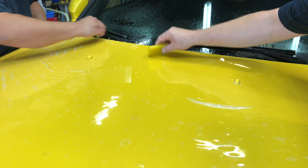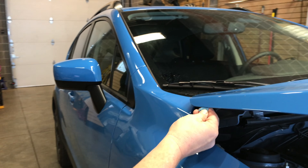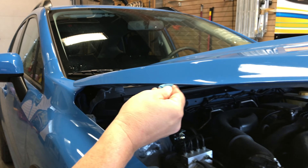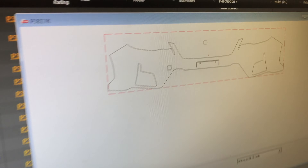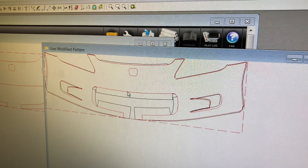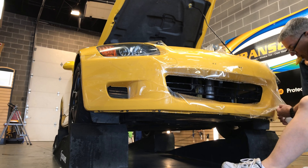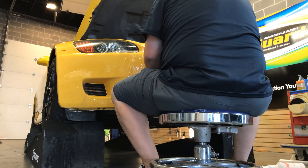You can lock the film in place by squeegeeing down a single spot, then continue to squeegee and stretch the film as needed to perfectly fit over the body panel. For areas like the corner of a hood where the film wraps around, Scott uses a little bit of Expel adhesive promoter. This has a molecule where one side wants to bond to the car paint and the other side wants to bond to the adhesive side of the film, which creates a strong bond at wrapped edges. Then it's simply a matter of working panel to panel, properly positioning and cutting the film for each area. While the vast majority of newer cars will have cutouts readily available, older cars will have to be custom cut. My S2000 did have some patterns available, but Scott also added his own modifications to provide a perfect fit.